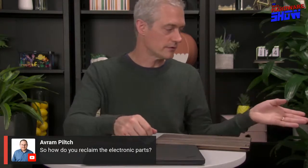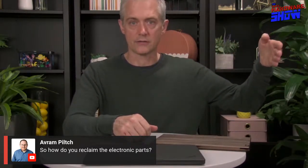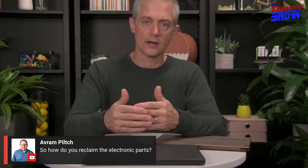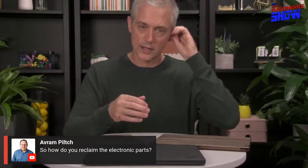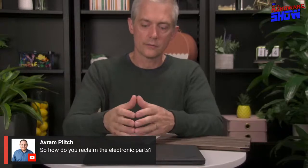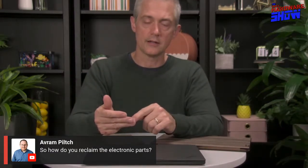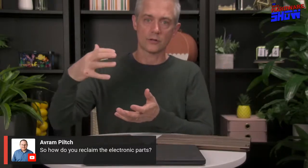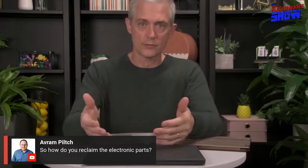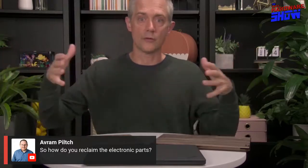And when I start talking about these, 75% recycled aluminum, 90% recycled mag, we're focusing more and more on what's happening at the end of life and building in the design so we can reclaim even more materials over time. But the other thing we've done, from a front end perspective, is that we own our own manufacturing, so we design, develop, and manufacture. So we have that end to end captured, and we introduced a low temperature solder process in the motherboard design that consumes less power, uses less energy, and we got such great yield from that we actually shared it out to the industry to drive the entire industry to a low temperature solder process. So we're constantly looking at the full life cycle end to end, since we own that end-to-end perspective.